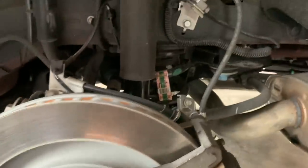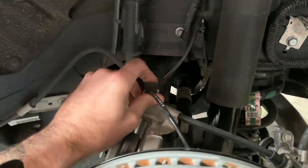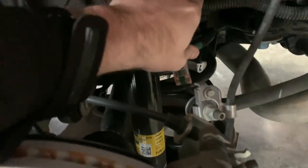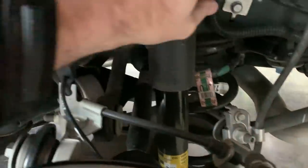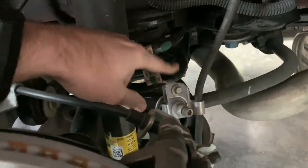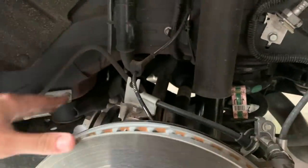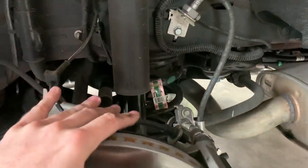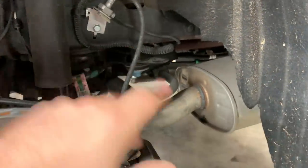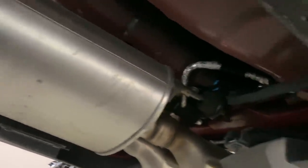To make life easy, we are going to take all of this apart. If you have MagneRide, you want to pull up on your stuff here — just make sure that nothing is going to hang up whenever you pull this down. That's a 10-millimeter bolt there for your brake lines; you're just going to take that bracket down. These are 18 here. Disconnect your MagneRide up there, and you don't have to mess with the sway bar. Make sure you have a jack underneath the IRS pumpkin right there so whenever we start dropping the entire cradle side by side slowly, nothing's going to get messed up. Then you've got two 13-millimeter bolts on each muffler — go ahead and disconnect that. And if you do have active exhaust, you want to disconnect that as you drop this as well, just to give a little bit more clearance.